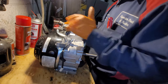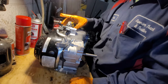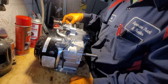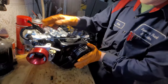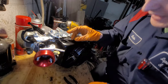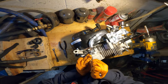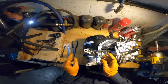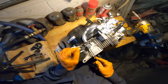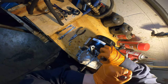In order to remove this arm, obviously we have to remove all the components that are connected to it. I would love to keep this portion — we'll see if I can; for now I'm not going to touch it. I still want to sort of use the limiter with the original cable so I can limit my speed whenever I need to. Let's pull the springs off of it. Needle-nose pliers work best on that. Once we pop this off, use a screwdriver to pry it a little bit open and slide it off.